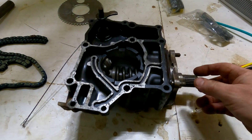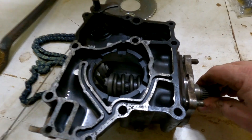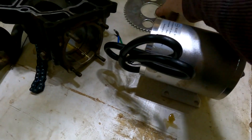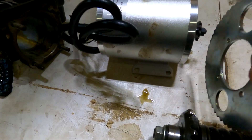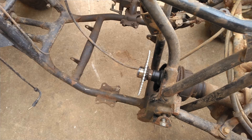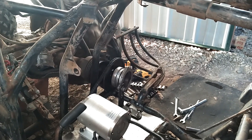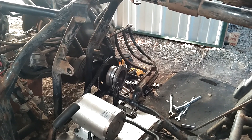This is the part off the transmission that needs to go into the drive shaft, and I need to find a way to make this connect to this. It provided a sprocket that could potentially go on the end here and then line up with a chain. I ended up cutting down the shaft and welding on the sprocket. The ongoing challenge was finding a way to hold the sprocket in place while the torque of the motor applied power to the wheels — quite a challenge, with a lot of chains flying off.